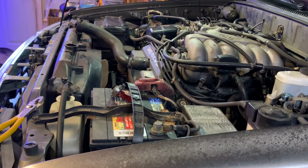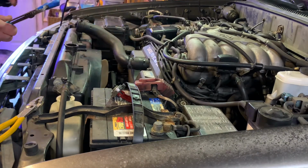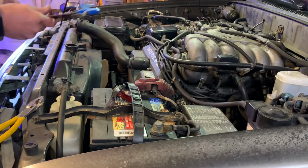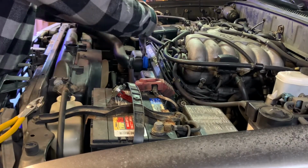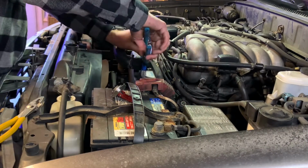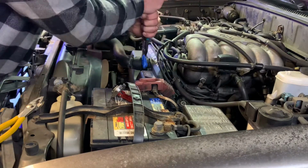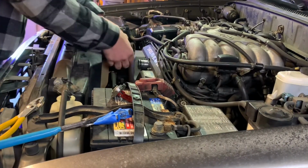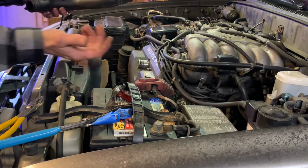Sometimes with the hoses, after you break it loose, it's a good idea to twist it a little bit. If you're going to be reusing your hoses, you don't want the teeth on whatever you're using to break it free and twist it to damage your hoses. So I've put some painter's tape on my channel locks. You can use masking tape, duct tape, or whatever, just something so that the teeth don't bite into the rubber hose. So, grab hold of it. Once it's twisted, it should come off reasonably easy. Yep. You can tell it took a little bit to twist it and get it off.